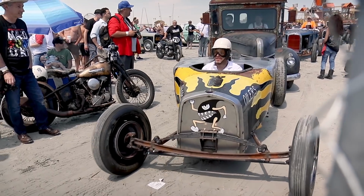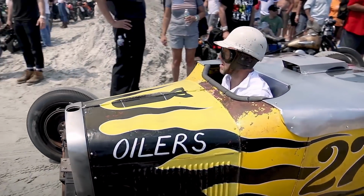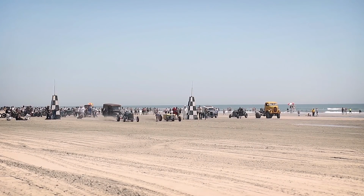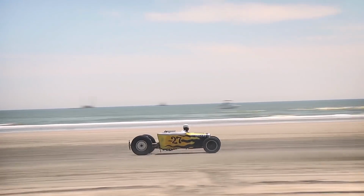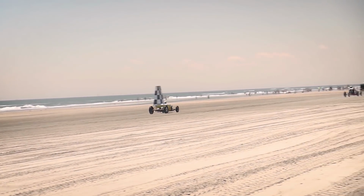And I did that and I got a pretty good run, and then I figured I'd shift into third a little soon to let the torque pull me with the wheels hooked up, and that didn't really work. It kind of loaded the motor up and started bogging a little bit. So I made 2 passes, and I feel like if I could make some more passes, I'd continue to get faster and faster. The car has way more horsepower than I was expecting.